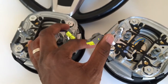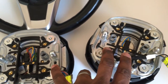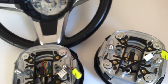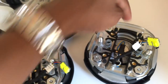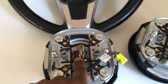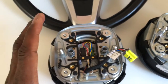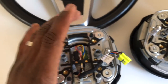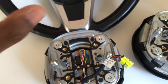The connectors are identical, so here's what to look for whether you're in the US or Europe. In the US, you cannot put a single-stage, single-plug airbag into a car that originally had a dual-stage setup. By US law, I believe all cars after around 1998 or 1999 must have dual-stage airbags. That means the car's computer is spec'd out to expect a dual-stage airbag system.